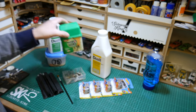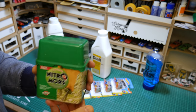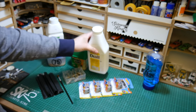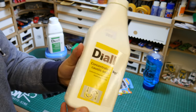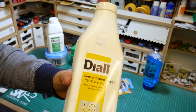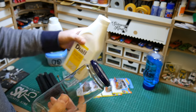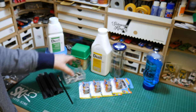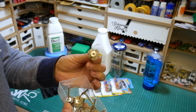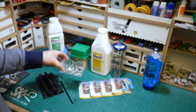You can chuck it in a little tub. The second one is Nitromore - a more worldwide brand name, more expensive at £9.42 for 375ml, and a little bit harsher. Onto the concentrated caustic soda - this is the most volatile of them. It's not my favourite, sitting somewhere in the middle at £5.87 for a kilo. You'll need a jar and a spoon to pour the stuff into. And finally there's the wire wheel option - a last resort for older cars rather than newer ones.